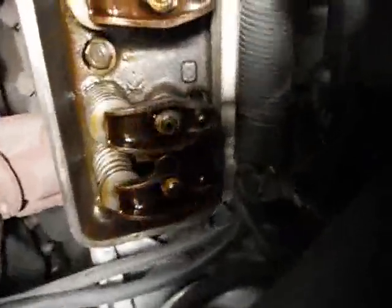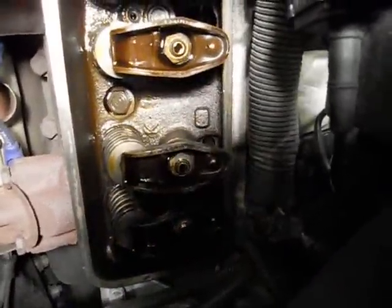When you look at your push rods — which are kind of hard to see but they're behind the rockers — if they rotate on a flat tappet engine then they are good. That's a good tip, but it doesn't work on a roller engine. There is a flat tappet lifter.